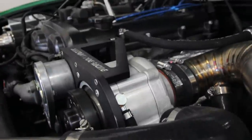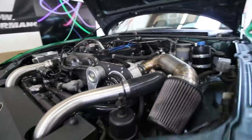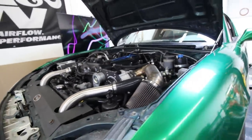I have to make sure the fueling is good and try to crank that up just a little bit more. Supposedly this setup, Rotrex C3094 on the previous car that it was on, made 295 on E85. Today, the car is just on 91 octane, so obviously not gonna be pushing it quite that hard. Hopefully, I'll see mid 200s, maybe 230, 240. I would be very happy with that. That'd actually be more power than it made on the 100 shot of nitrous, except I get to enjoy this all the time without having to refill the pesky bottle.